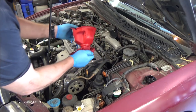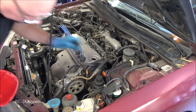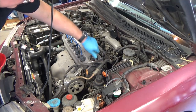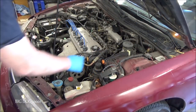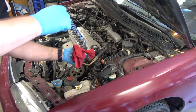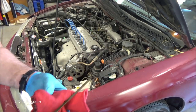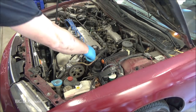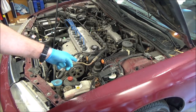We can just take our cap off, put our funnel in, and dump all four and a half quarts in. We'll get our cap back on. We'll let that oil settle for a second and then check it — make sure we've got some on the dipstick before we start the vehicle. It's always a good habit to get into — that'll prevent you from starting it without oil. You can see it's got plenty of oil, so now we'll start it.